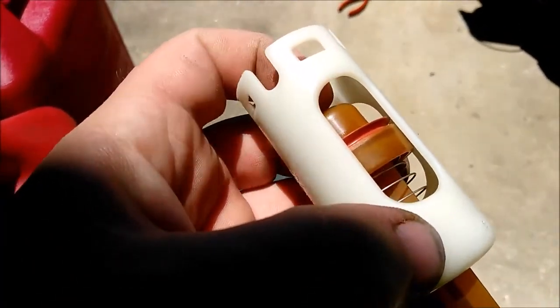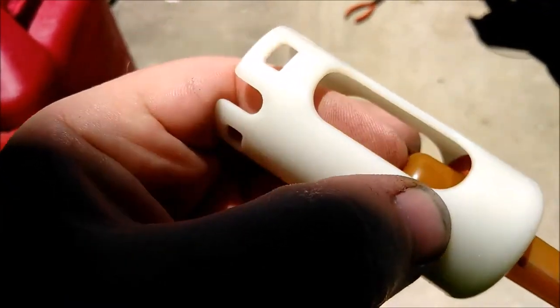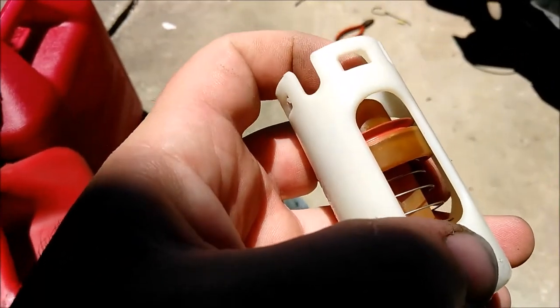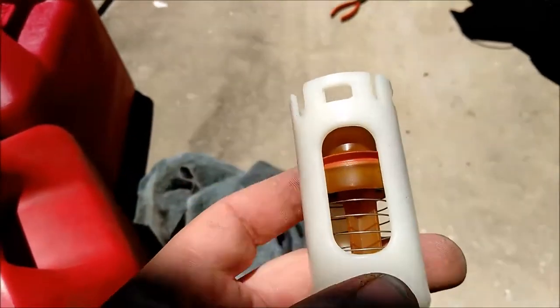As I'm pushing it, it's still getting stuck. It's getting stuck in the open position, but it would allow fuel in. Mine was stuck halfway, right about there — so the fuel isn't enough to push that down before it backs up and shuts the pump off.